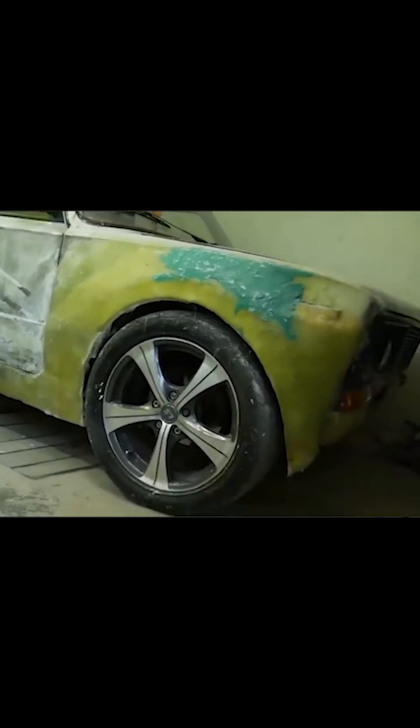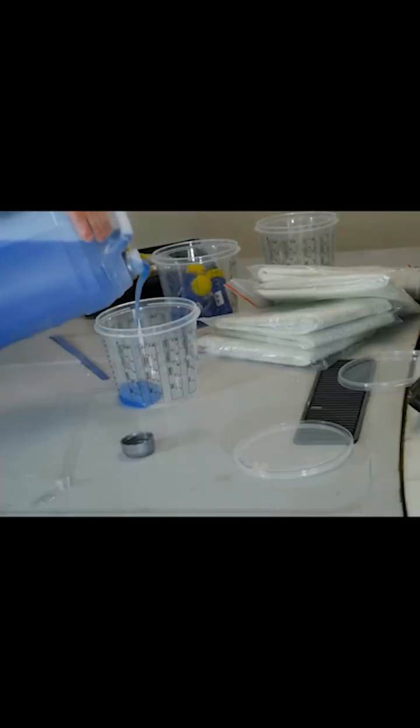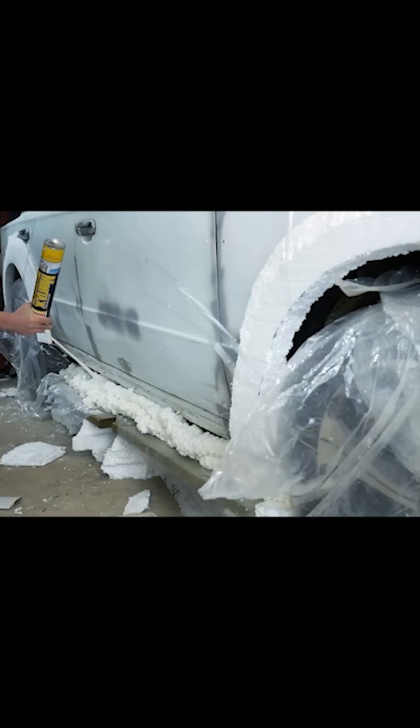The main way to create a body is with polyester resin and fiberglass mat. If you're doing a one-off tuning, then spray foam and a utility knife will be enough. You create the desired shape from foam and polystyrene, and then everything gets covered with fiberglass.